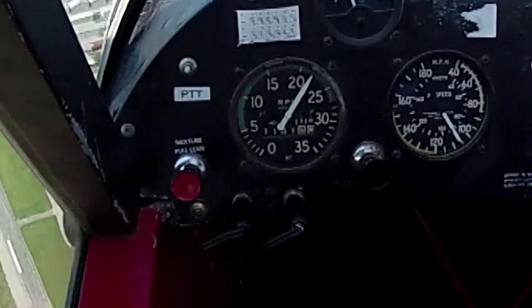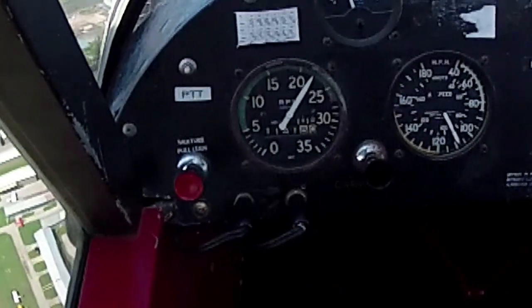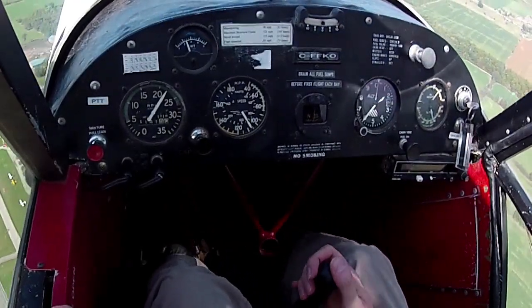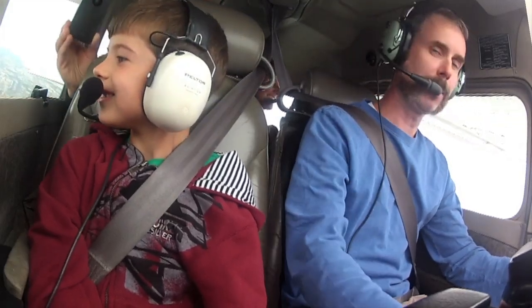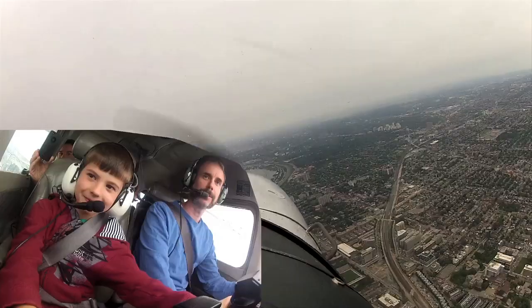For an airplane like the Super Cub, you're definitely looking at the bush pilot technique. All you've got is your mixture and your RPM. It's a matter of leaning it until the RPM peaks, then it'll start to drop as the engine starts to starve, then just push it back in, get the RPM to peak again, and get it just a little bit rich of peak. That's assuming you have a fixed pitch propeller, like you also do in the 172R, so you could look at RPM — but if you've got an exhaust gas temperature gauge, that's more precise. You might as well use it.